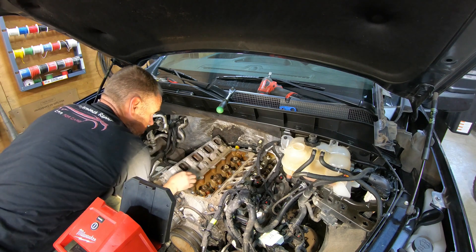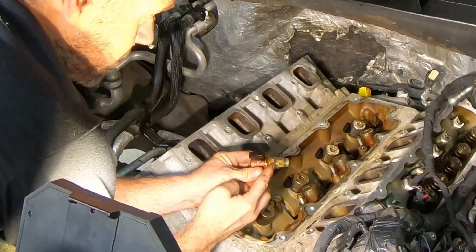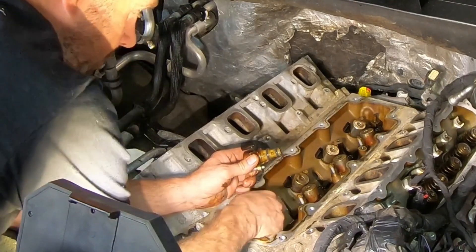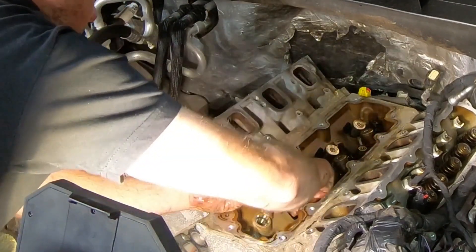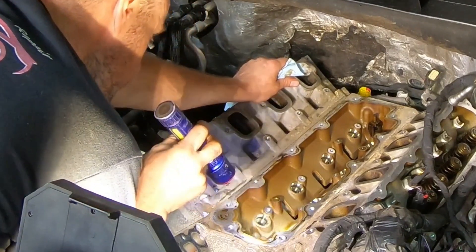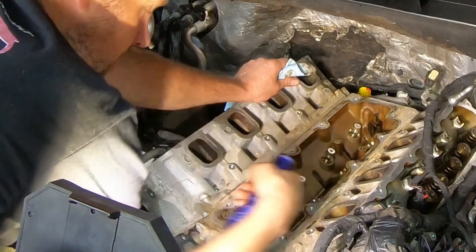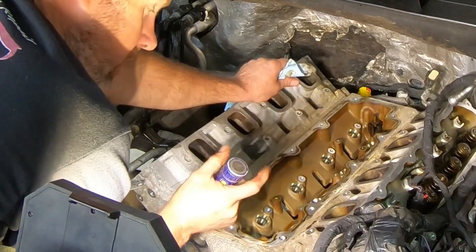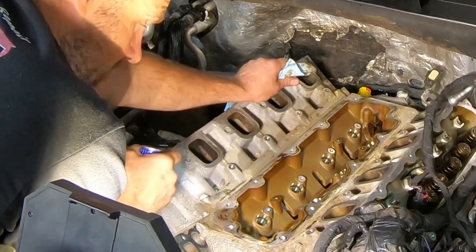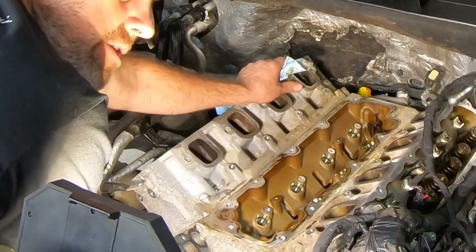Just as expected, we have a bunch of bolts holding these solenoids in place. Here's the first solenoid — you can see there's two different chambers. One's going to be main oil pressure from a main oil galley of some sort, and the other one is going to be what sends it to the DFM side of the lifter. Looking at this, it's pretty self-explanatory once you look at it. The center of that solenoid has a hole all the way down — just a machined hole with different steps. The smallest hole goes down right into the main oil galley, so the center of the solenoid gets main oil pressure and then disperses it out the top, into the side of the largest part of the hole, which then has a cross-drilled hole to feed the sides of each lifter.